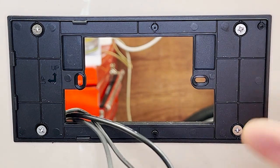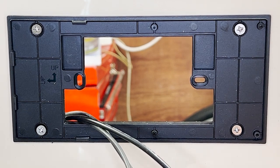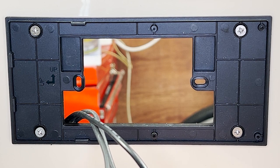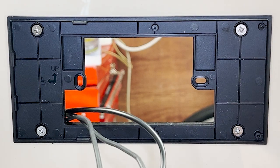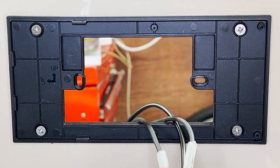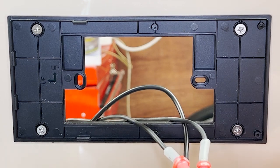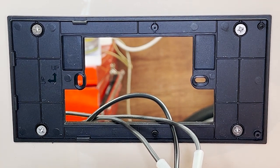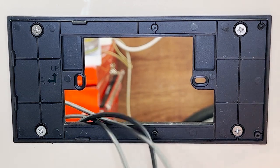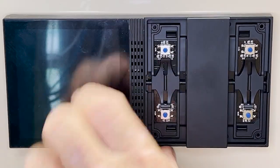All the cables have come through, and something to think about when you're installing this unit: you've got potentially three switches, which means six cables, plus a power cable, a CAN bus or RS485 connector, and a USB Type-C — all of which have to come out from behind the panel. That means running them through conduit and cable runs. Since you may add components later, you need to think about how to access and fit those cables neatly and safely so they survive the life of the van.